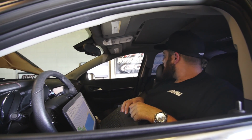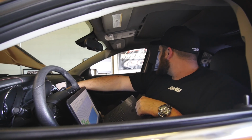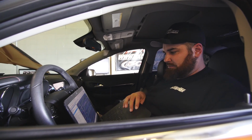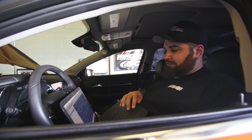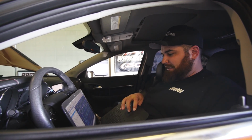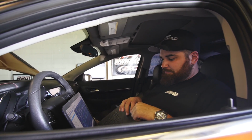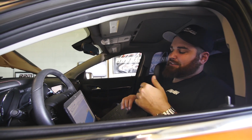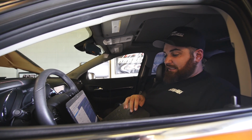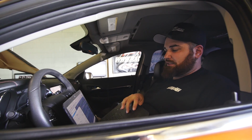Is boost staying steady now? Not dropping off. It looks like it's dead straight across the board. You can go verify that if you want, but it started out like 157, 158 kPa, and yeah, it actually increases at the end. It drops to like 155 in the middle at like 5,000, but then it goes up to 162 kPa at 6,300, so yeah. I can't do kPa conversion in my head. Like 8.2 pounds. Like 160 kPa, you have to minus atmosphere, so generally 100. So you just do 60 kPa is 8.7 pounds.